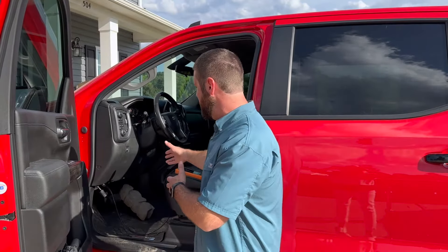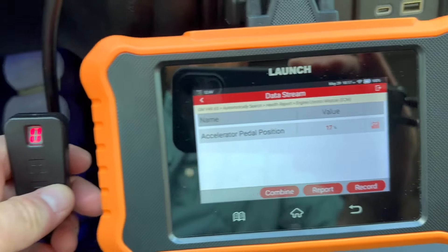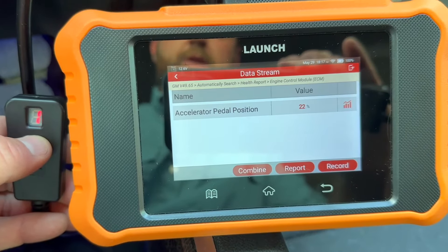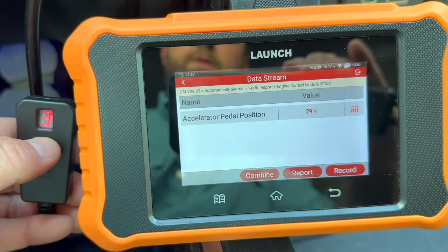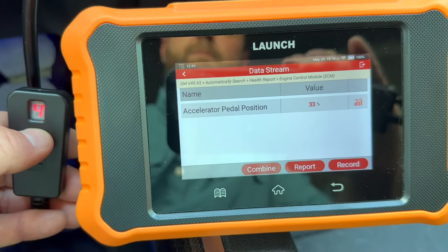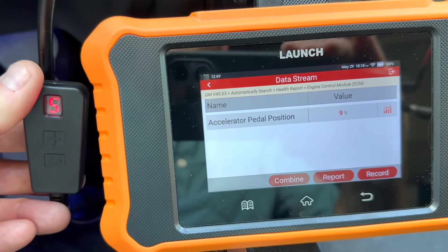Next test — we've got a really nice edging brick that is pressing down our accelerator pedal. I've got the brick pressed down on the accelerator pedal. The value we're getting is 18%. I've got the Jet Performance Throttle Controller, called the accelerator. If I hit the one position, it cranks it up to 22%. Position two: 26%. Position three: 29%. Position four: 33%. Let's see what happens when you go to the valet mode, which is supposed to be a lot less throttle response — that's number five. That dropped down to 9%.